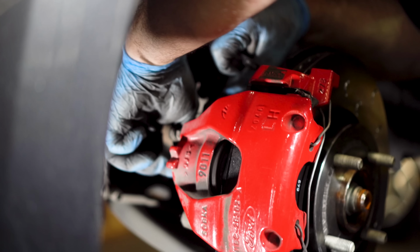It's also worth connecting the hose support to hold your new hose close to the connection on the solid brake lines. This will minimise the amount of time the brake line is disconnected when swapping them over. To swap them over, loosen off the nut on the top, remove this circlip style thing, and then unscrew the hose from underneath.